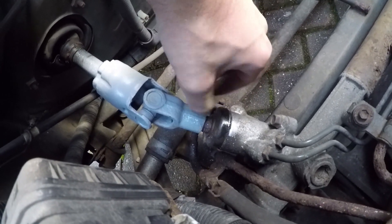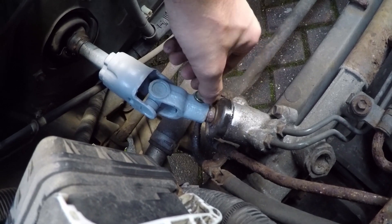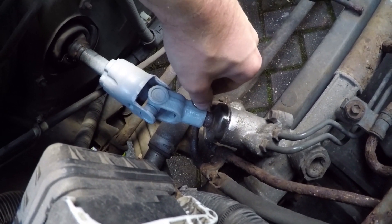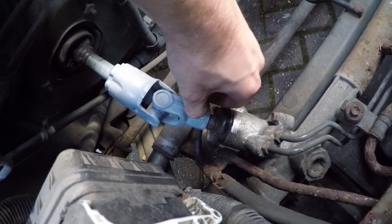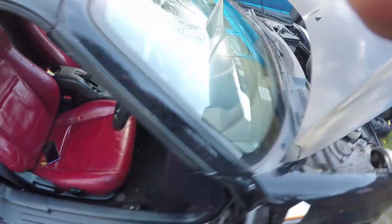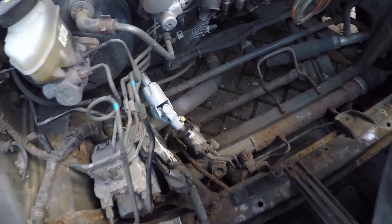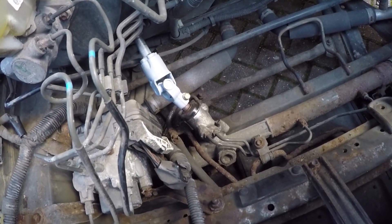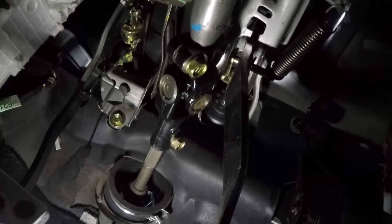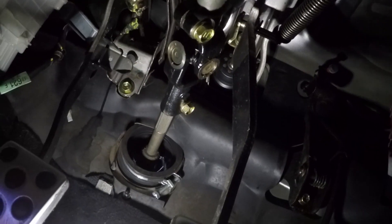When you're tightening these up using your breaker bar, it doesn't matter if the universal joints wobble about a bit, because the splines should make sure the steering wheel is aligned. If you get back into your car and the steering wheel isn't perfectly straight, don't worry — it will hopefully, if you've done everything right, line up properly once everything's buttoned up and all the bolts inside the car are done up nice and tight.